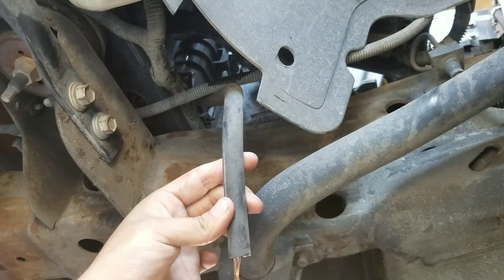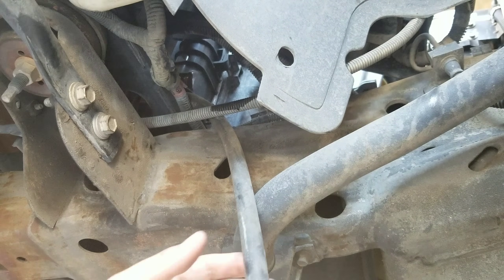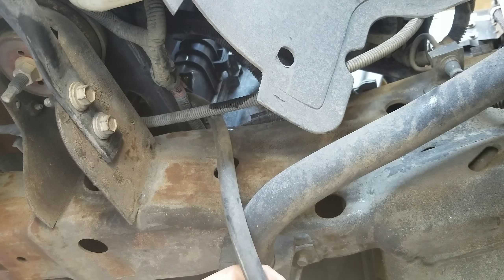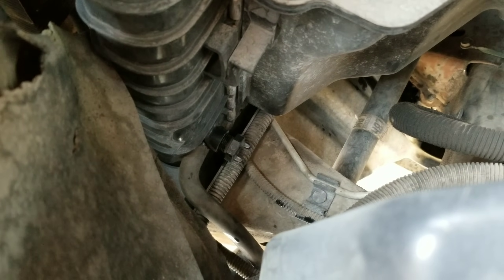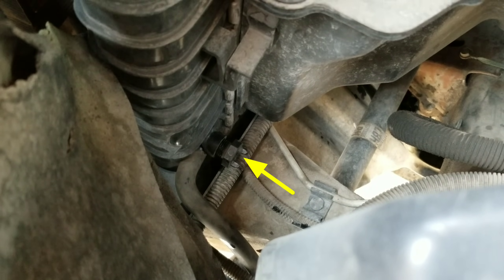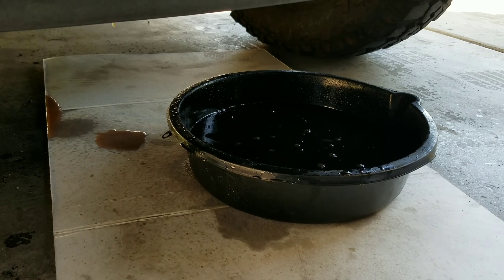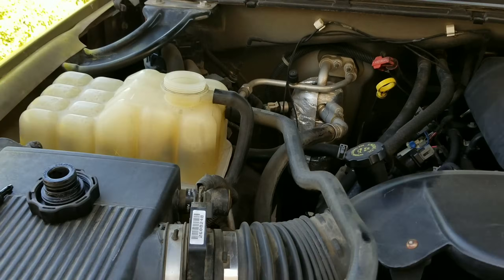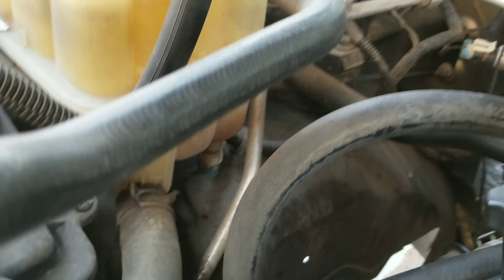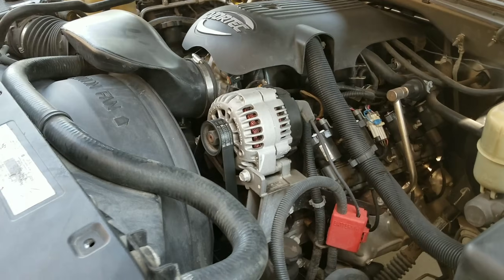The fluid is coming out of this hose right here, but it's also going to come out from the side, so make sure you have something to catch it. Looking through the engine bay you can see the drain plug better — it has two tabs sticking out, which is what you rotate to remove the coolant. It's going to be a little messy. It's taking a bit longer to drain the reservoir, so I'm going to turn on the vehicle momentarily to drain all of the old coolant out.